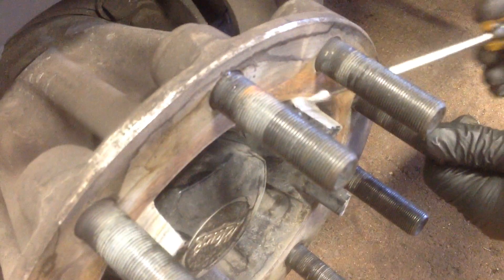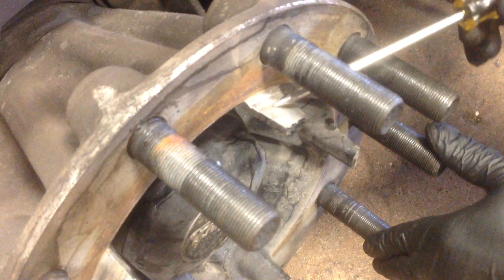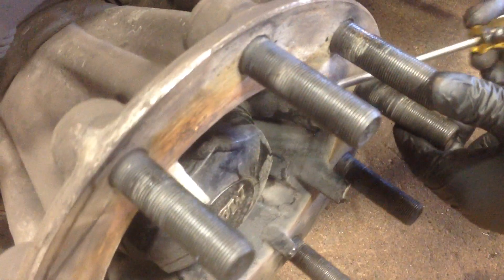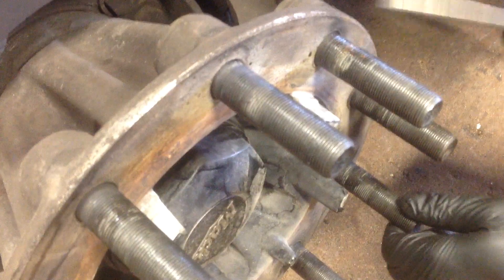Let's go to the two, Mark, that are absolutely gone. This is an aluminum hub. Sometime in the life of this truck — probably around 300,000 miles — somehow or another, some repair facility did not install this outboard drum properly and actually shaved off two of the pilot areas that centered that drum.